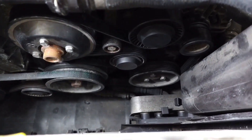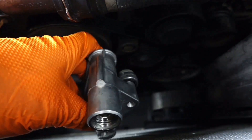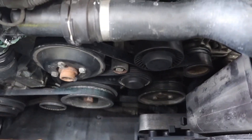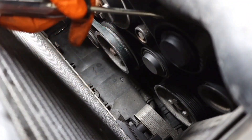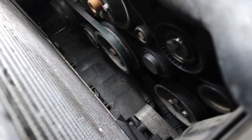Now that I've got the fan out and a light in there, you can see things a little better. Right there is the hydraulic tensioner — you can see the ridge on the back, the top ridge. Look down there and you can make out that it is definitely the hydraulic tensioner and not the mechanical one. I'm going to pop this dust cap off — your car might not even have those anymore.